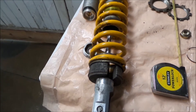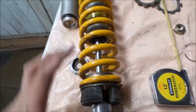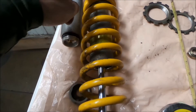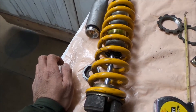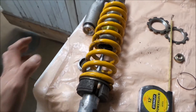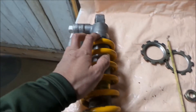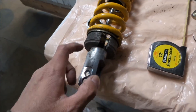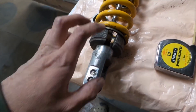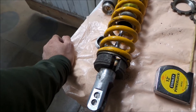It's still a shitty shock. But normally you would adjust the sag and everything — there would be more than four inches of travel. You'd probably have to adjust this collar all the way down to get more travel. It's a game of playing with adjustability. It's nice that they give you this — there are more ways to lower the bike. You can use the preload collars to adjust the height, though you're not supposed to. And you use this bolt and collar method to lower the bike. That's how it works.